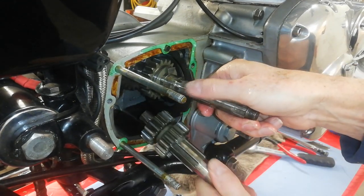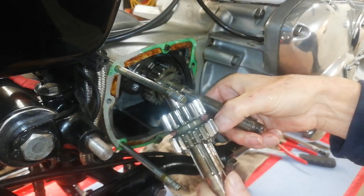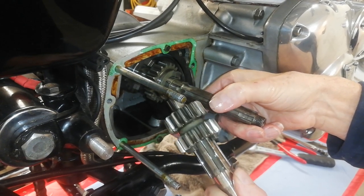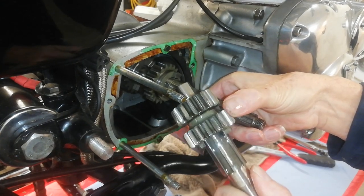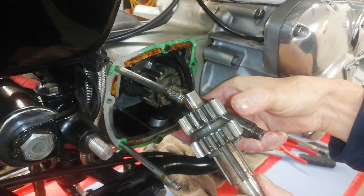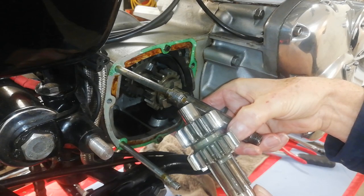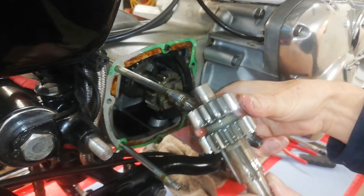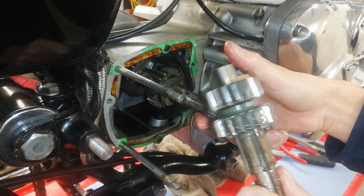The lay shaft is now clear. These last two gears — I think that's fifth and fourth gear — they stay on the shaft. It's very important to make sure these two gears don't lock together. On earlier models they can get too close and actually lock together, and then they both try to engage at the same time with horrendous consequences, especially if you're doing 70 miles an hour down the motorway.